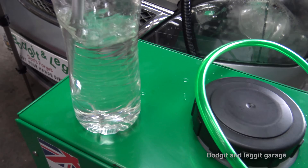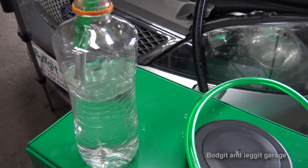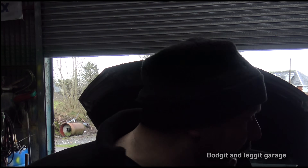I've got my battery maintainer on. If you want to check you're producing hydrogen, just put the pipe in some water and all those bubbles are pure hydrogen — simple as that. Now I'm going to put that in the intake. This is a 2.2 diesel so I'm going to leave it on for around about an hour — that's a little long but I'll do it for an hour. You can probably get away with around 45 minutes. Every 10 to 15 minutes or so just give it a rev and see if you can see any carbon coming out. This car isn't completely clogged but I'm doing it for the purpose of the video.